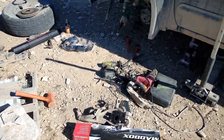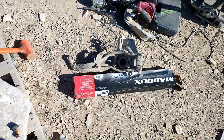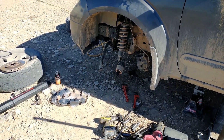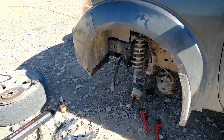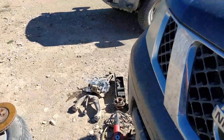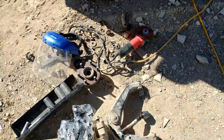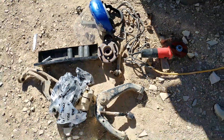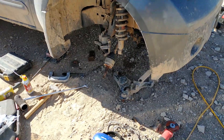This week I've been working on the Pathfinder. The hubs have been grinding a little for a while, and we had a kind of spooky drifting at 60 miles an hour — it would drift back and forth, almost like it was out of alignment. It was actually the ball joint on the passenger side tie rod. You can see this piece here is pretty sloppy — that was letting the wheel wobble back and forth when it was under tension.